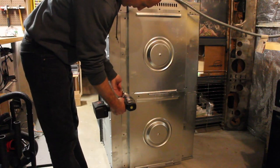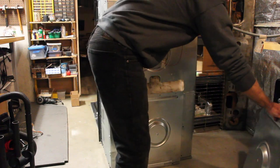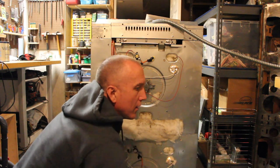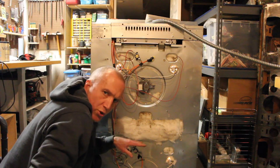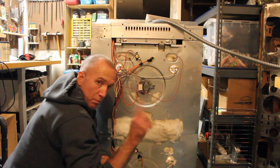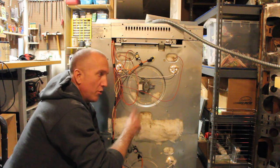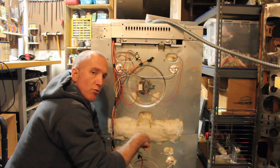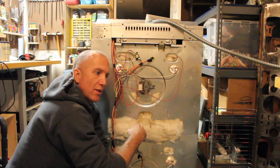Let's take off these back plates. Now we've taken off both back panels. This is your wiring configuration, but this isn't what you're going to see when you first open it up. I've already removed a few of the wires and switched up a couple things, but I want to show you something you need to take care of. This unit is a double digital unit — there is no manual dial on it. Since both of these ovens run off a computer, you have to figure out how to hotwire the computer so that it thinks both ovens are in sync.